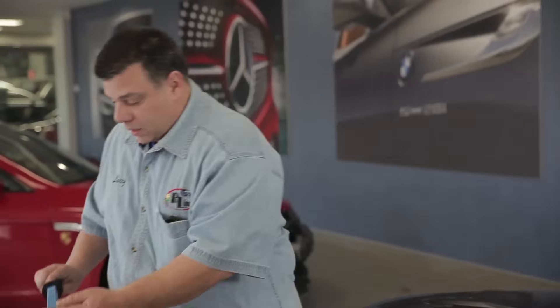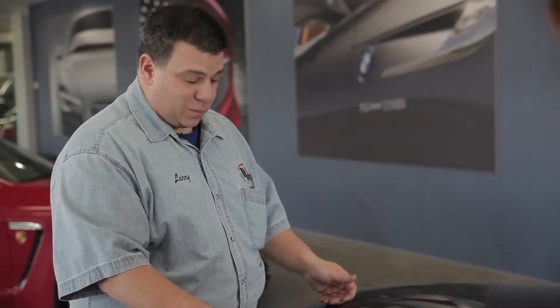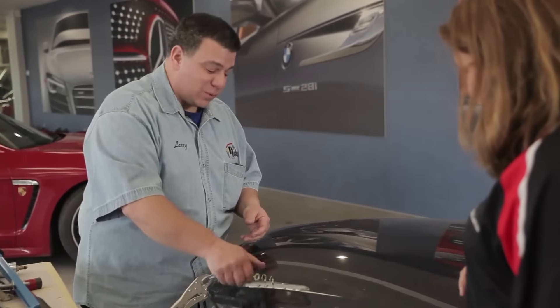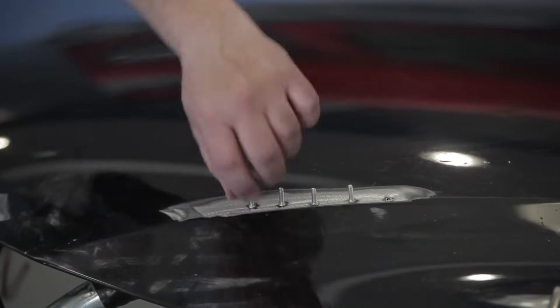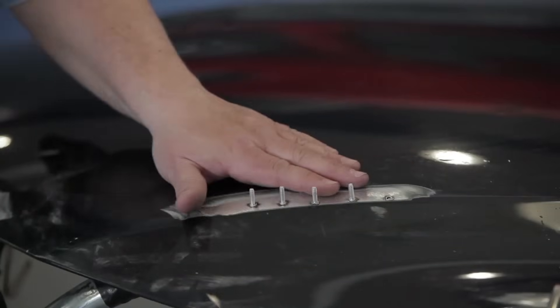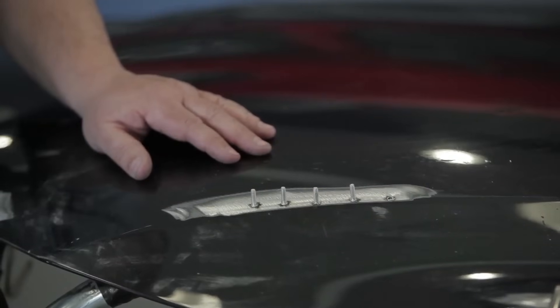Here's another trick everyone has to realize: don't grab the pins right away, because you just heated the panel and aluminum transfers heat to these stainless steel pins very quickly — they can burn you badly because they don't look hot. Most shop technicians trained on steel cars would grab these with vice grips and twist back and forth, which would make a hole. What you have to do with aluminum is take a pair of diagonal cutters, clip them down as low as you can, and file — not grind, file — across the top to get them level. They actually become almost part of the repair process or get sanded off later.